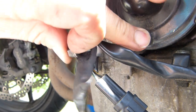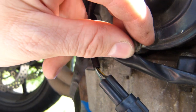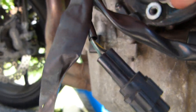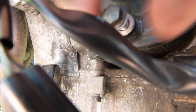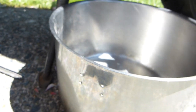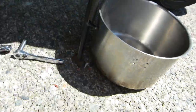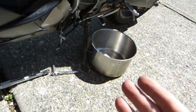You can just hold it in with one hand. If somebody can put another washer on it and then install it again, only a minimal amount of engine coolant will be lost, and that's easy to refill. But just to plan ahead, get ready for it. These are some of the implications or consequences that are involved. So this is draining. That's one point that you need to touch. And you also need to work on this bolt while you flush the system. So make sure that you capture all of the engine coolant, make sure that pets and dogs don't lick it up from the ground, and there is no contamination. It's a toxic material. It's not super hazardous to the environment.